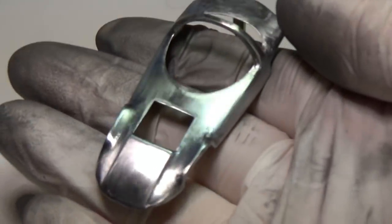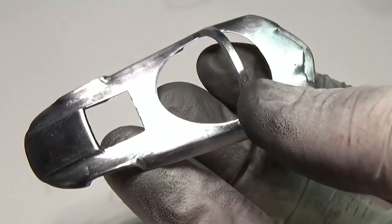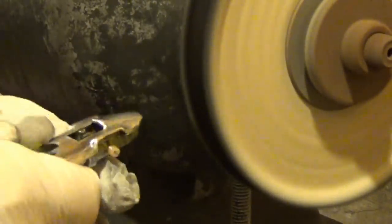Here's the car after I've sanded it down. I'm starting to get a little worried because I've noticed discoloration in the metal all over the car. This happens on these old cars and usually can't be sanded out. I'm going to polish it and get a better idea of how bad the discoloration is. To polish the car, I use a buffing wheel and buffing compound. The compounds come in different abrasives — this black one is coarse, available at home improvement stores like Lowe's. This will remove the scratches left by the 600 grit sandpaper. When I'm done, I will switch to the other side of the buffer and use a green compound, which is a fine grit and will remove the small scratches put in by the black compound.